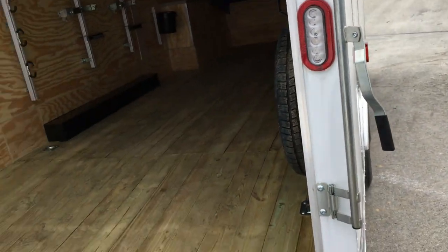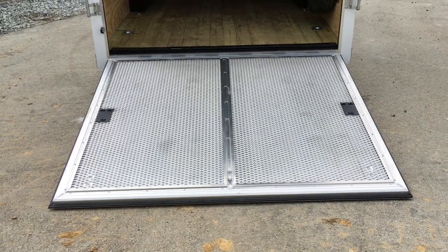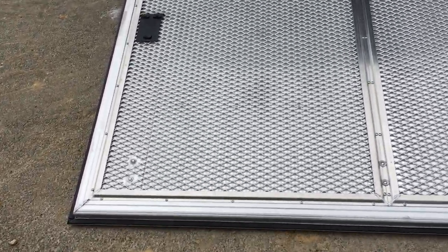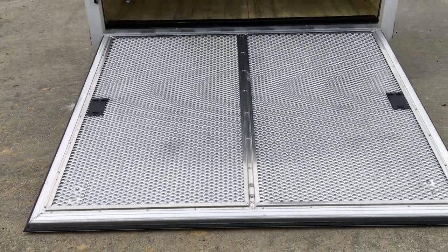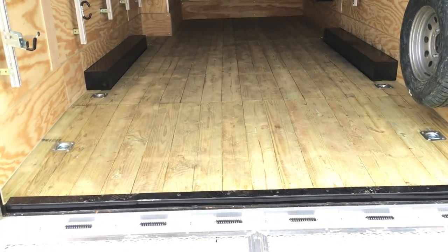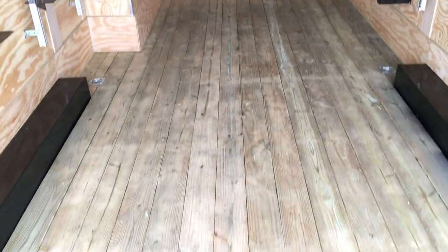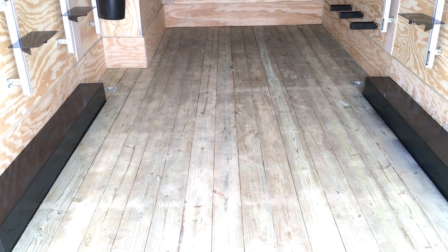What you see here is an all-aluminum door. A regular steel door would be far too heavy with the cable-less system, so they go with an aluminum door. They put extra uprights in the door, and this particular unit has expanded mesh aluminum on top of an extruded aluminum plank — so it's an all-aluminum door that, even being aluminum, is very, very heavy-duty. Instead of a traditional plywood floor, they go to a 2x6 pressure-treated plank. Some of these units they do with a beaver tail; this one appears to have a 4-foot beaver tail. You can also elect a pressure-treated floor with or without a vapor barrier underneath — some landscapers prefer no vapor barrier for added ventilation.